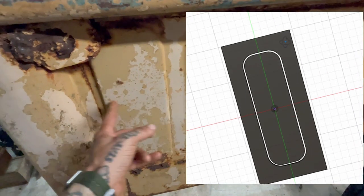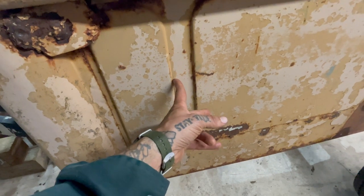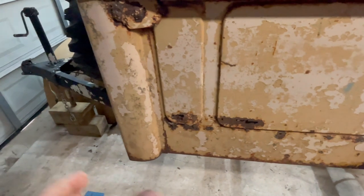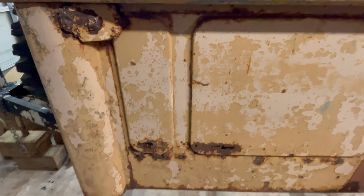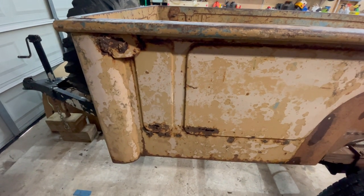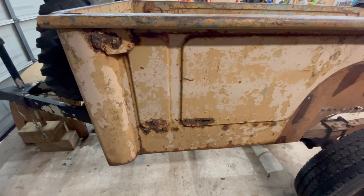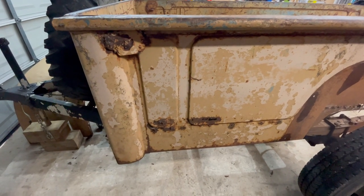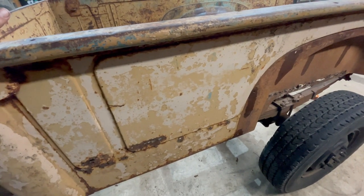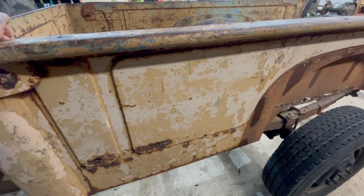To get the measurements, I used magnets with right angles pushed up to the edge of the indent on the red bed, then measured across and inside and outside the magnets. I've got a buddy, Isaac from Icy Weld, who said he'd get the dies cut. We talked about how to do it — for this grade of steel you need about 55 tons of press. Isaac has a 65-ton press. If I can get the dies made, we'll go press out a bunch. That would really put this project ahead — and would likely be useful to the whole International Harvester community.